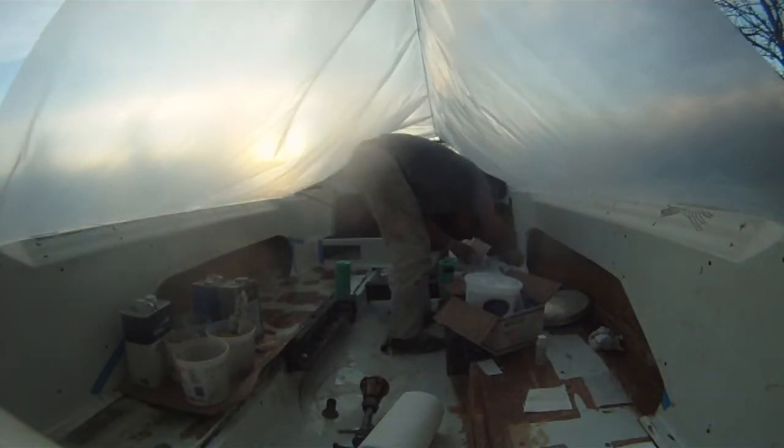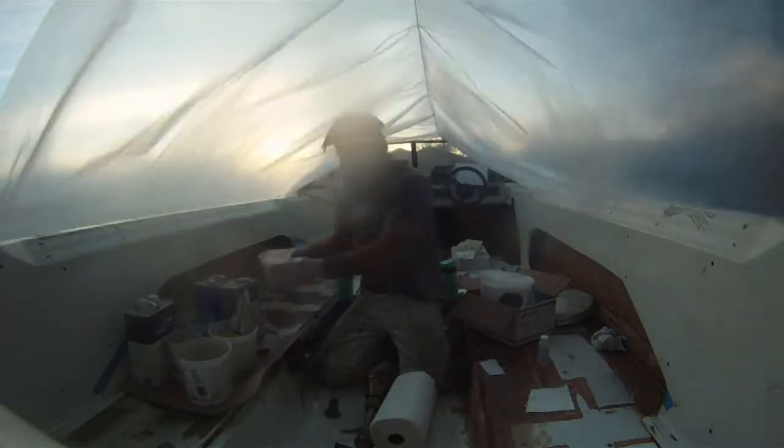First, here I am doing a little peanut buttering work that needs to get done — smoothing things out, filling little holes that I dremeled out before, filling out the holes on the underside of the engine mount, getting all those sealed up. Then I mix up some resin and finish fiberglassing back under where the gas tank is going to go in, getting prepared for a gel coat.